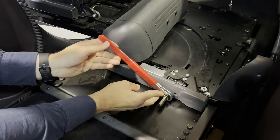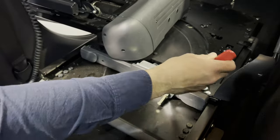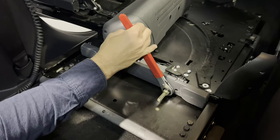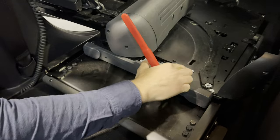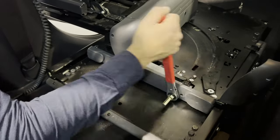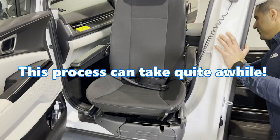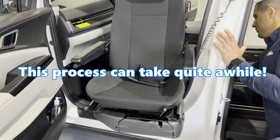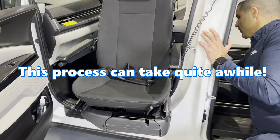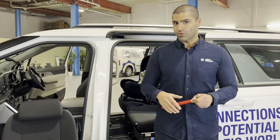Once the gear has moved, put your crank tool in and crank it anti-clockwise — counterclockwise. This may take some time as there are quite a few revolutions for the gear to complete. We just showed you how to crank the unit with no one sitting in the Turny and assuming there's no power to the unit at all.